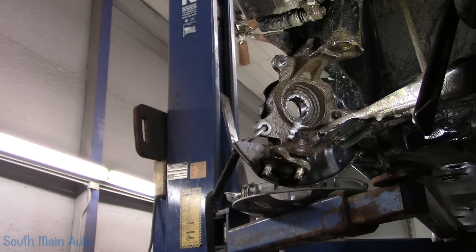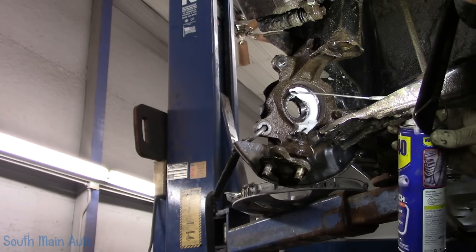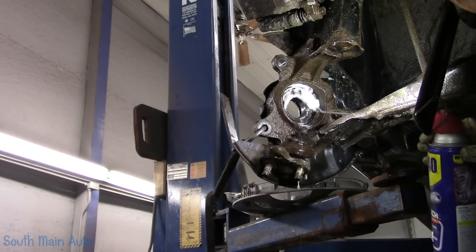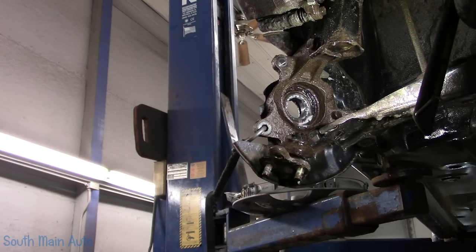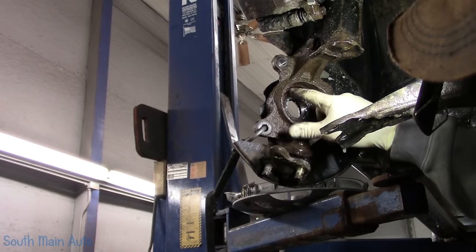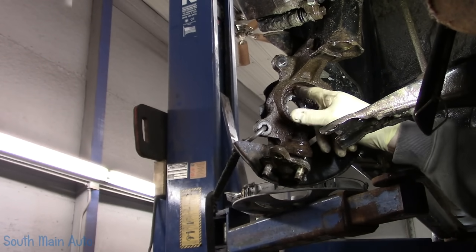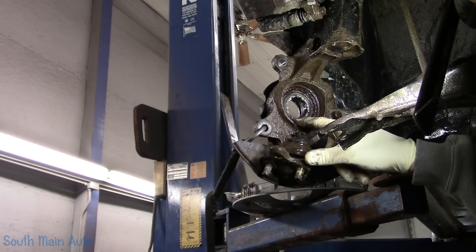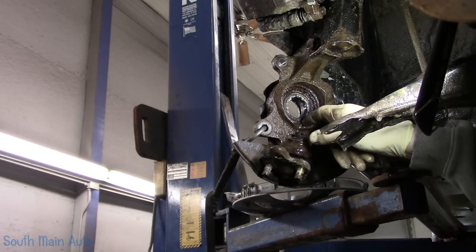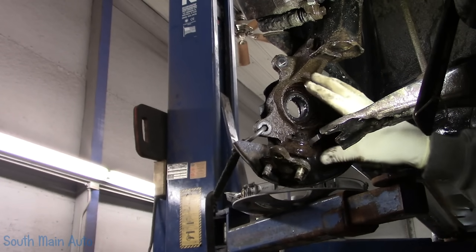So we're down to the dreaded snap ring on the backside of this wheel bearing. Now, viewers have sent me various types of snap ring pliers, whatnot, and what have you. My weapon for this is the air hammer. The snap ring in here is rusted and solid, I'll tell you that. So we're gonna just go around very gingerly with the weak sauce air hammer. We're gonna be using the Mac one, so the lowest on the totem pole, power-wise. We're just gonna massage this ring, I like to say. Just massage the edge of it. Try to get it loose.